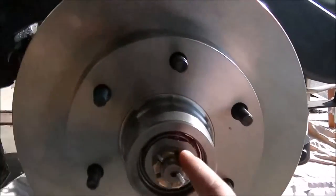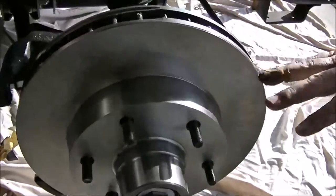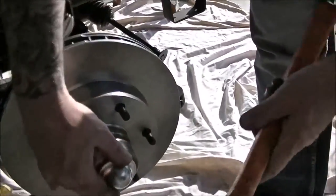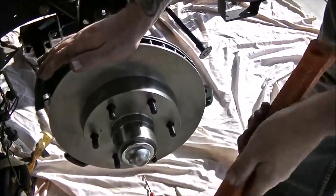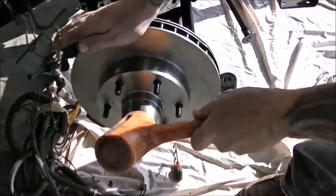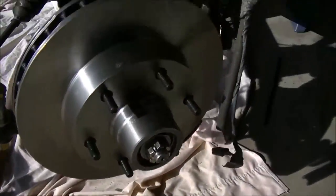So we just got everything tightened down on the hub - got it all tightened down and put the cotter pin inside of it. What you want to do is tighten this till it doesn't move, and then turn it back a quarter of a turn so that it does spin a little bit. Make sure the cotter pin's in, and then after about a hundred miles of driving it we'll check it since the truck is so custom. For a normal truck you'd want to check from 300 to 500 miles.